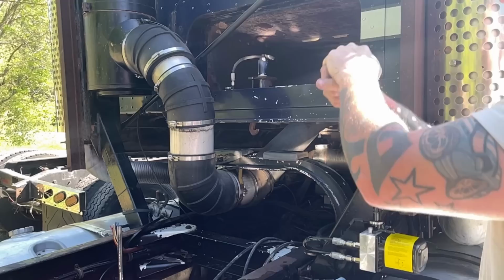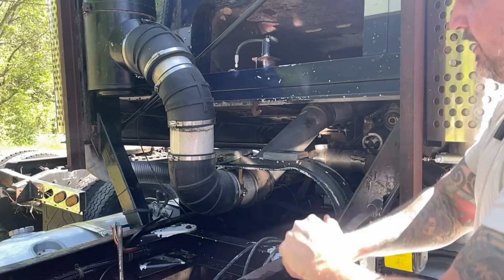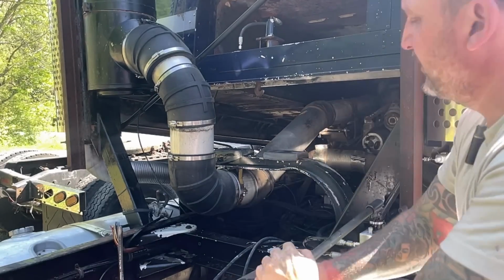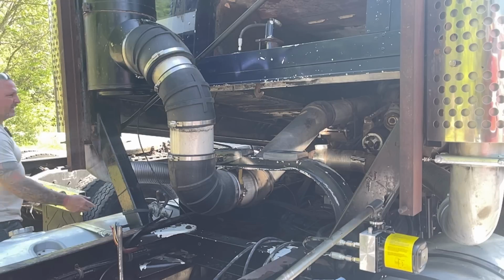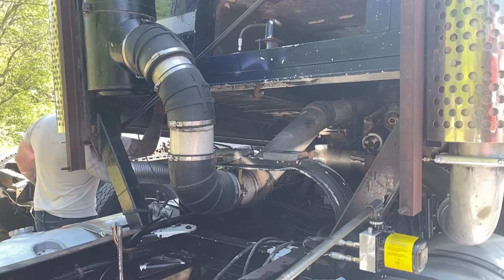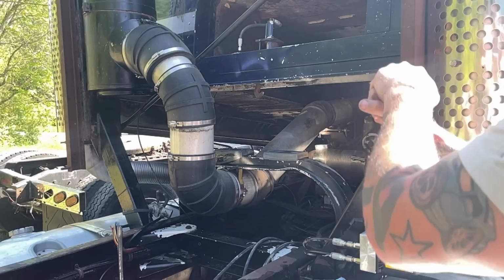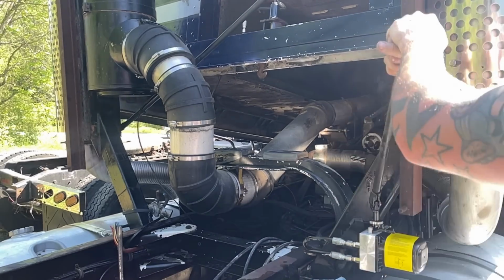The other thing is this truck doesn't have any safeties in the cylinders, so what we're gonna do is we'll order new cylinders for this truck and we'll change them. For now we're just gonna go through and use it. The only thing we got to remember is there's no safety, and so we won't be under the cab unless it's locked via 4x4 or the cab safety latch, which is not for you to set it on, it's just in case it comes down.